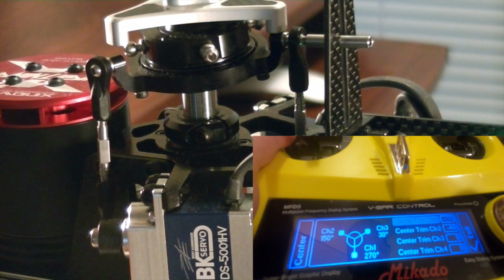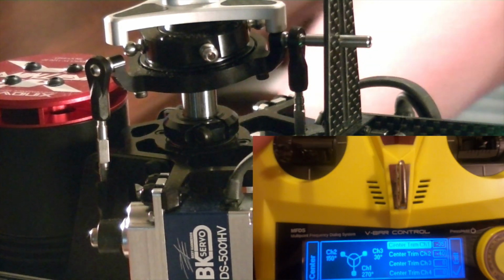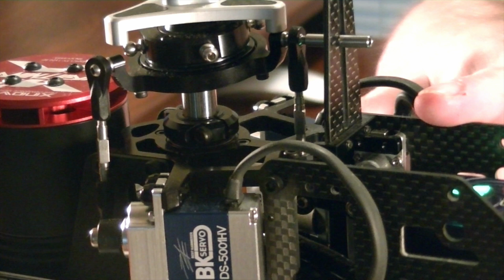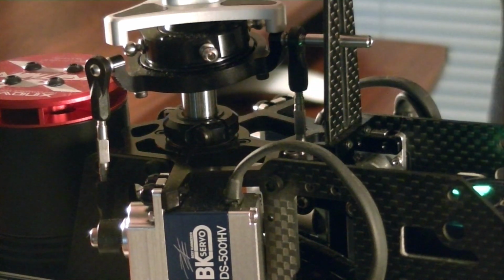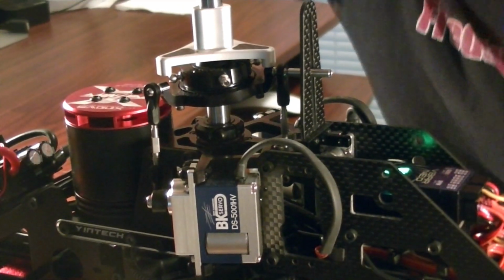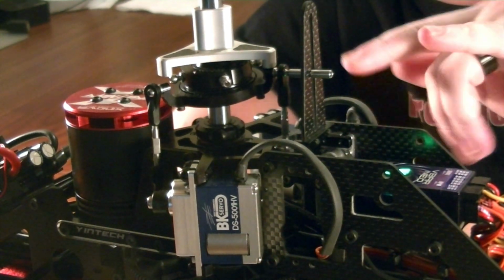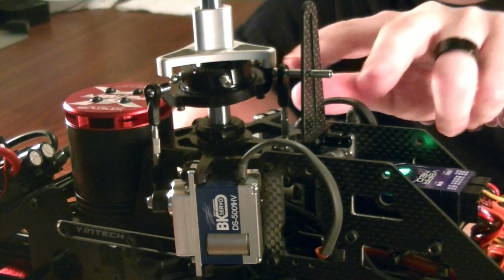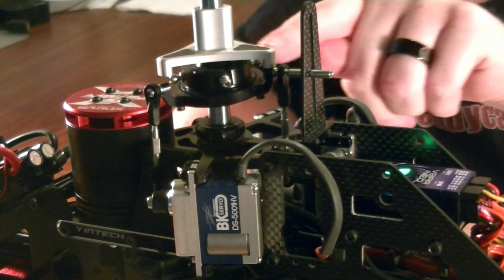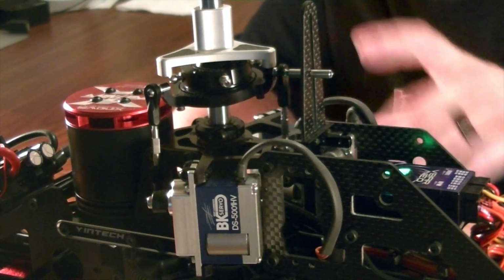Boom, okay? So, we now know that these two are good to go, right? We now have our channel 1, and I believe this one, the other side, was channel 3. My servo is now at a 90-degree angle on these two, and due to the length of my pitch link arms, we are perfectly level right here, okay? So, let's move on to our next servo.